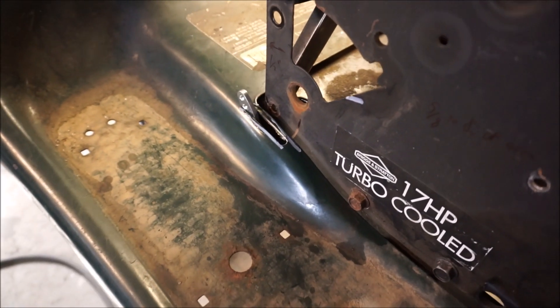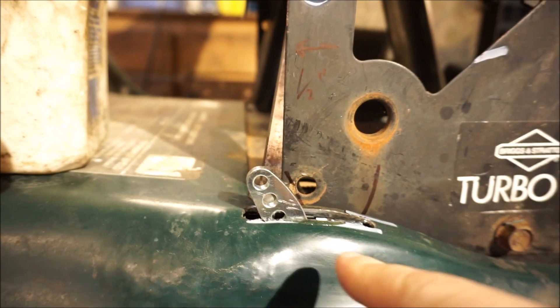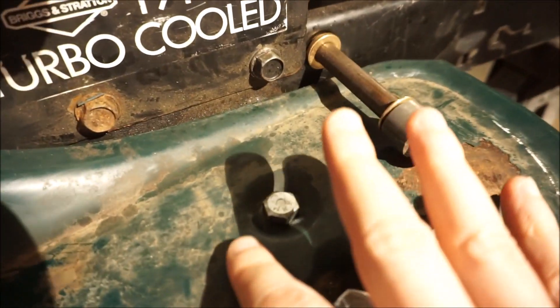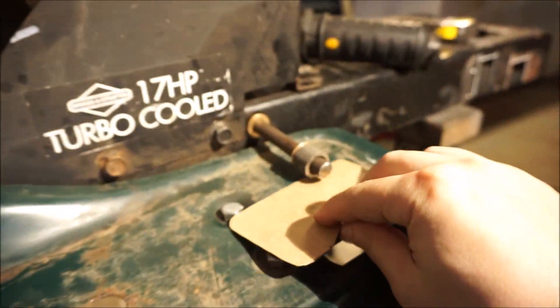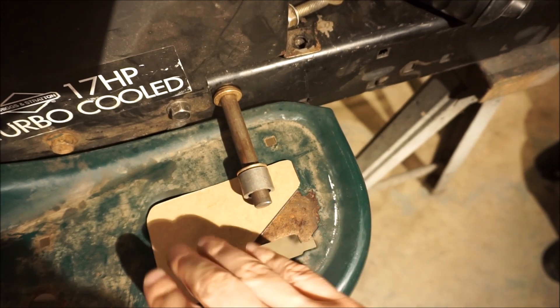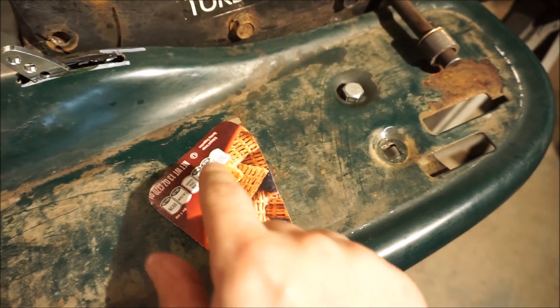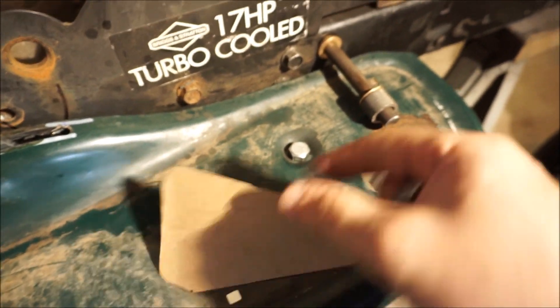You can see where I pounded away at that fender — I have a light on it so it looks worse, but I've got a hammer and dolly to smooth that out. Here's the lever setup. The lowest hole will give the least leverage off the brake pedal, so I won't be using that one. I drilled my extra hole right here and made this little template out of Life cereal box — cinnamon Life. I'm going to cut that out of quarter-inch plate steel with an angle grinder, utilizing both back holes and a front hole. I'll also need to weld some standoffs so I'm bolting against solid metal.